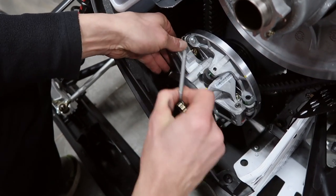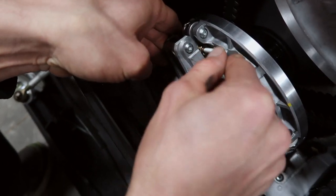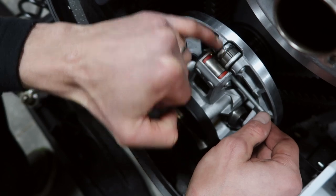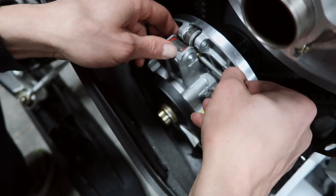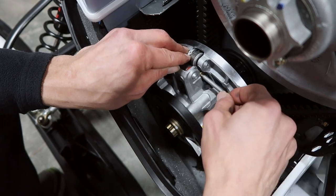To adjust your clickers, you get to this big gold weight — it's actually a bolt, but it's the weight for the clutch. When you roll the clutch this direction, you can see a two, a notch in the middle which is a three, and the next number is a four. All you do is loosen this off a few turns until you can actually rotate the clicker.